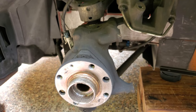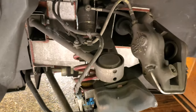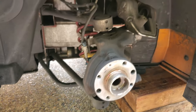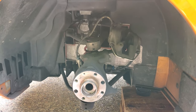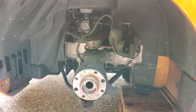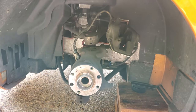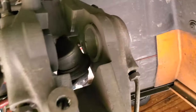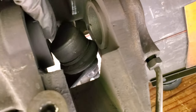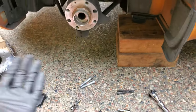Now everything is pretty much pulled off — it turned out to be much simpler than I thought. Just take a look at all the suspension in here: it's really light, really thin, very small — lots of unsprung weight saved. Now, this being a British car, it still has some British quirks despite the Japanese engine. Part of that includes the fact that suspension members can come apart and get loose, especially the toe links for the rear hubs. So if you're an Elise or Exige owner, it's a good time to check all of your suspension links and make sure everything's nice and tight. Now it's just a simple matter of slotting in the new pads, compressing the cylinders in the caliper so we can get the much thicker pads in, and then cleaning up the caliper pins a little bit before everything goes back together.